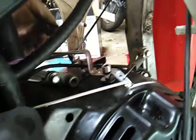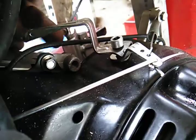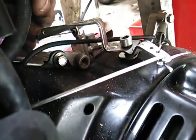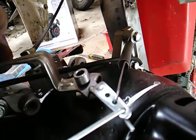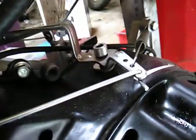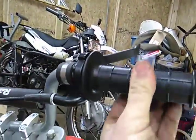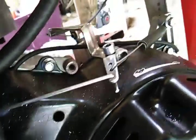You're probably wondering how I did the throttle. I literally used the existing stuff. I took a spring, hooked it up to a bolt up there, bolted this piece on, and then I twisted the throttle lever so it would be perpendicular to the handlebar. Now you can come up here and turn this throttle — which was about 12 bucks — and you can see that thing's pulling.